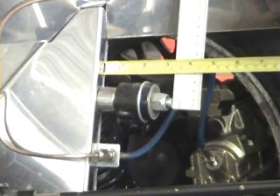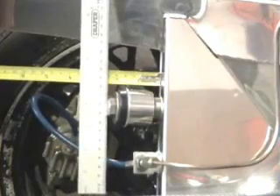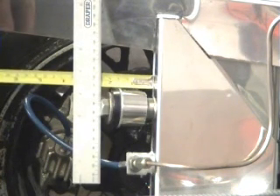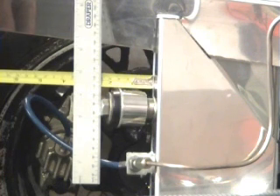This is the standard arm which had been packed back to give us 6 degrees castor angle, and we've got about 85mm. This is the new arm fitted in the forward position, so I've got a distance there of 60mm — so we've gained just over 20mm clearance on the header.